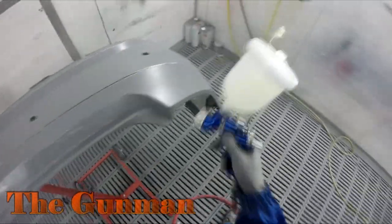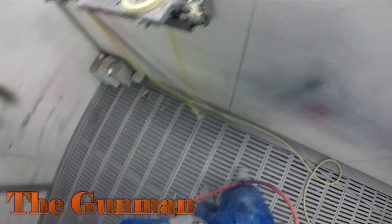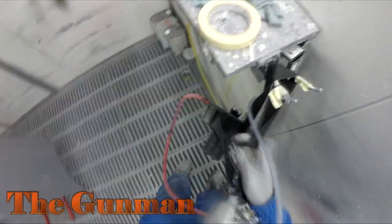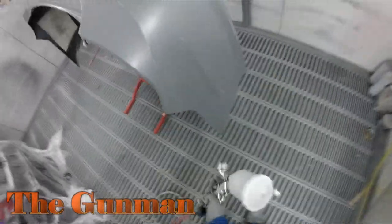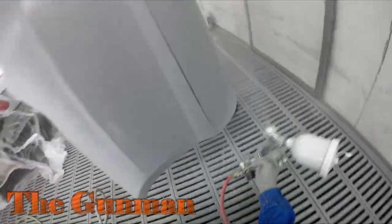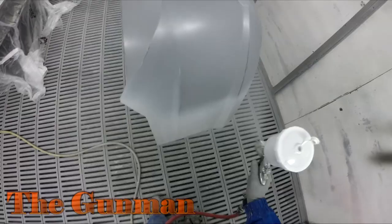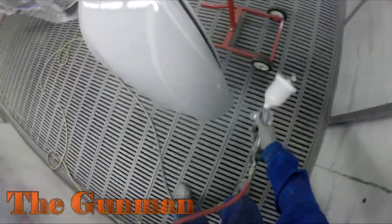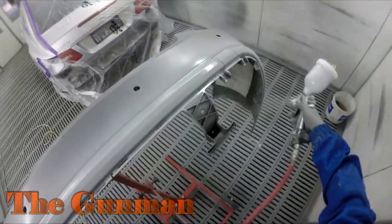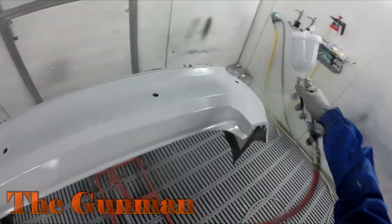I did use a bit of wet-on-wet primer as well, just to help seal that down — a two-pack surface over the top. The 222S did do wonders because there was a big edge from a previous spot repair halfway up that door. I wasn't going to put the wet-on-wet primer that far up, but I still dusted a couple of coats of color over there and was still able to blend it — no real shrink back, no mottle. I managed to get out of jail on this job, and that's probably just through experience.